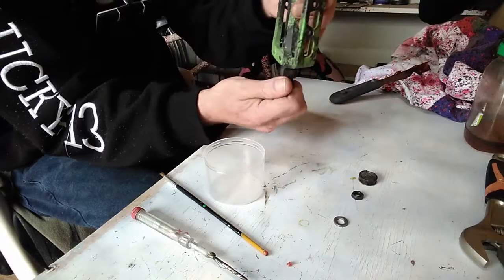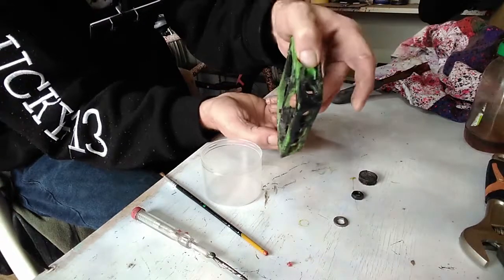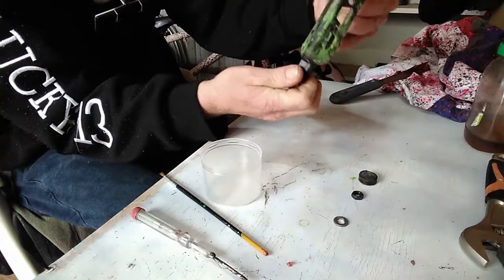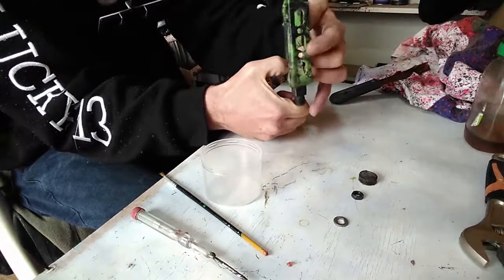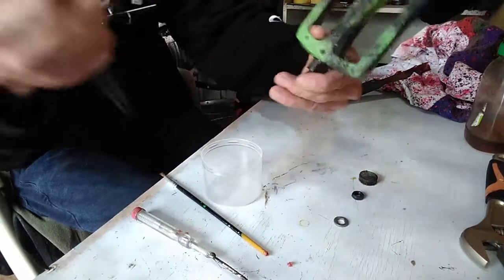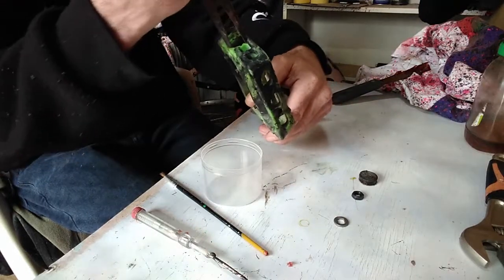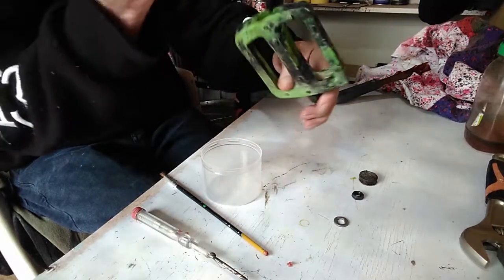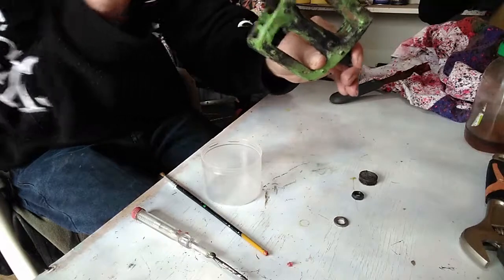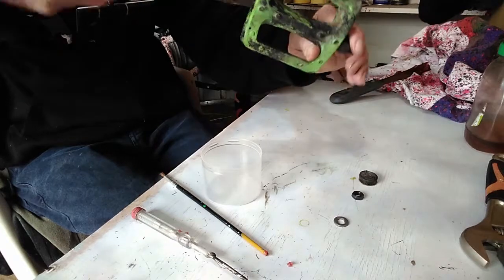And then slowly at the base of your pedal, just slowly tighten it, holding down the nut with your thumb until you can't reach it, keeping everything tight. Letting go down here, your bearing highly possibly could fall out. So once again, putting in those pliers because I don't have the right size for this, and just tighten it up, but don't over-tighten it.